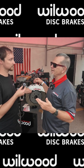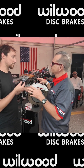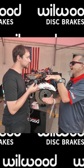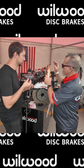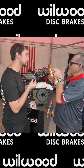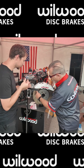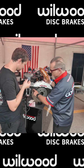As that efficiency is happening, what ends up happening to a rotor when it gets hot? Well, as that rotor gets hot, it wants to expand. And as it expands, we start having problems because now we've got your caliper on a tangent with the rotor spinning. As we clamp down on the rotor, it pulls it apart — it wants to start stretching, especially at the very hottest point of the rotor. That's why you start seeing cracks in the middle of rotors.